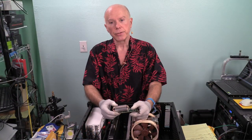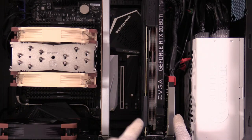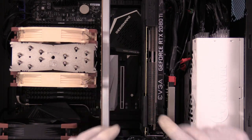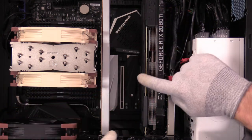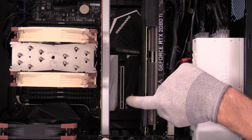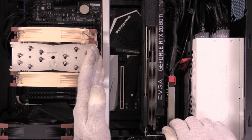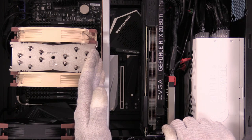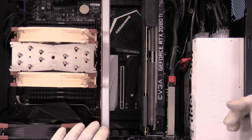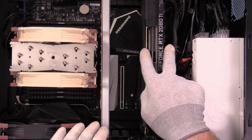This is the Gigabyte TRX40 Designare motherboard, where we have two 16-lane slots and 2 8-lane slots. We're going to be using the primary 8-lane slot that's already bifurcated, so we have 4 lanes bifurcated in the BIOS for each one of the 2 drives that are going to be in that slot. That's an 8-lane slot. The 2 16-lane slots on the primary is the Gigabyte Aorus M.2 NVMe PCI Express quad adapter, and in the second 16-lane slot, we have the EVGA RTX 2080 Ti that's 2 slots wide.